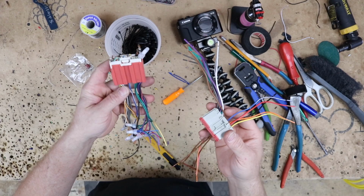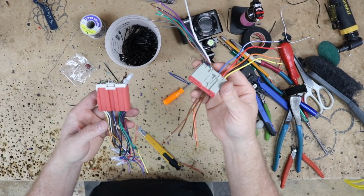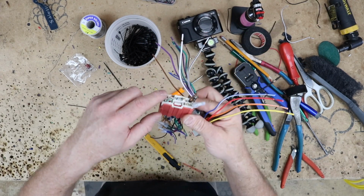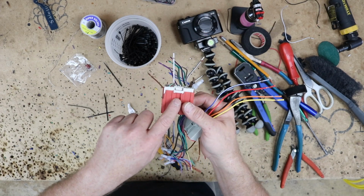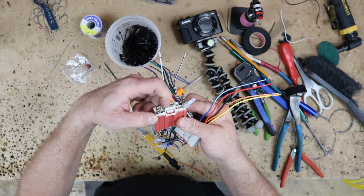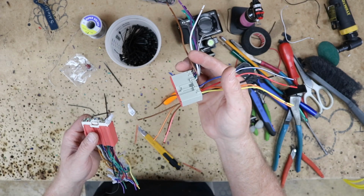What we're going to do in the Mazda is reattach a harness. As we said, we're going to use this Ford harness. We only need to worry about the wires that are in this plug. Well, that'll make things a little bit easier. The one wire, however, that is not in this plug is the amplified antenna wire for some reason. So this white red right here is the amplifier turn on. It's not in this, but we'll go ahead and make sure we add it to ours.